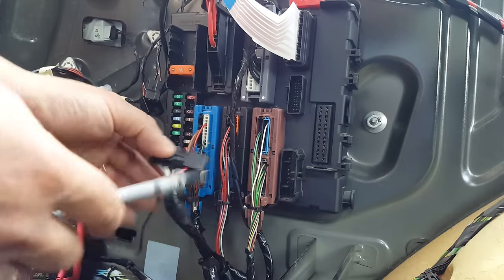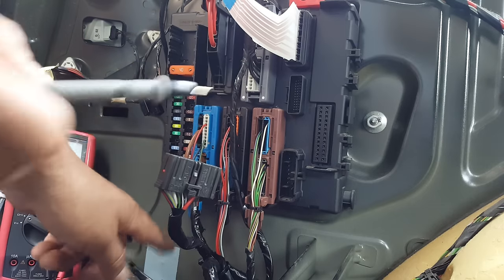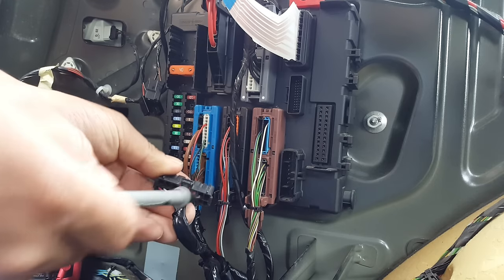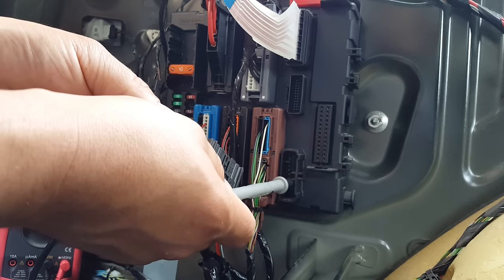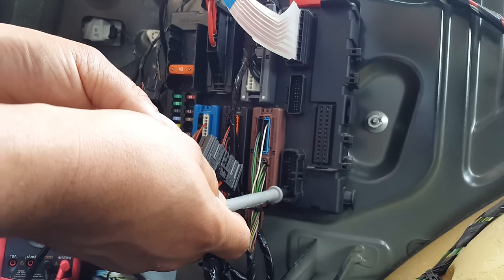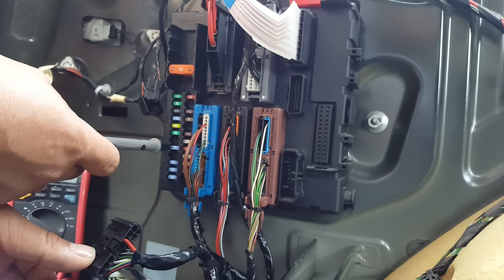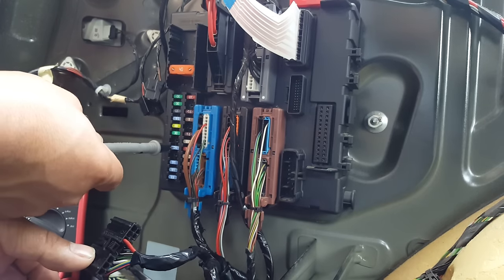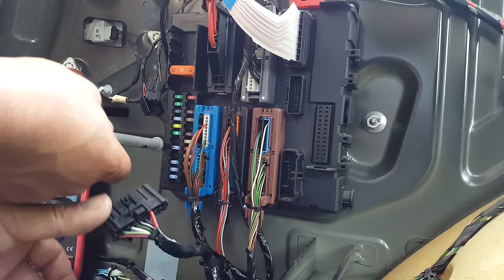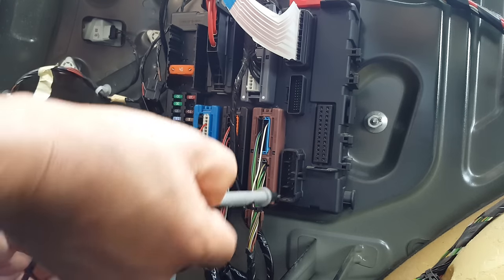The ground, when I got this cable, the ground was cut at the back somewhere, and this red wire here was put in here. On the right you have two pins. One is ground, the top one, and the second one is power. This power comes straight from this fuse, F13, which I believe they put the fuse in just to see if that would work, but that doesn't power the lights. It is a straight power into this pin. I'm not going to even take the fuse out because that is not going to be used.